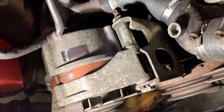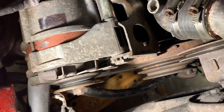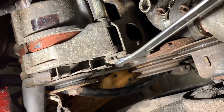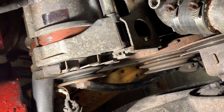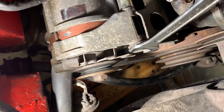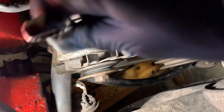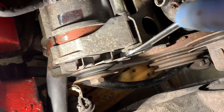What you may find is if your fan belt, V-belt or alternator belt is worn out, it may have stretched and the adjuster is as far as it goes and you're still getting some squealing - in which case it's time to replace the belt altogether. When you come to replace the belt, you'll want to turn this nut the other way to loosen it off and then take the belt off.